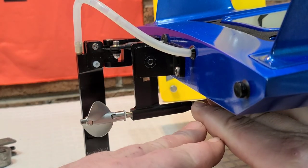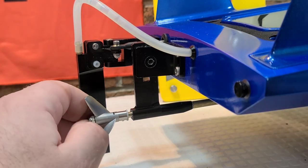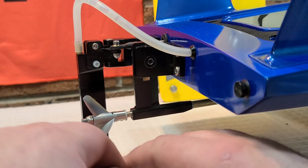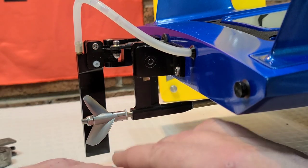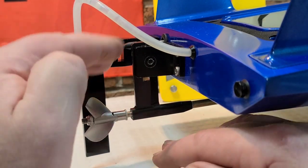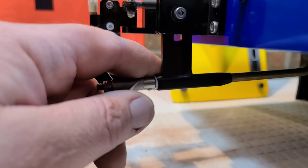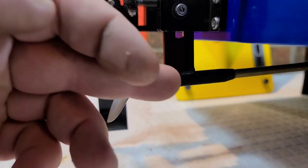They make these boats with a long stuffing tube so you can actually tune them yourself — cut the stuffing tube to length yourself. I'm going to push this up so it barely goes into the collet up here. So basically we only have that much cable in the collet — it's not very much for the collet to grab onto. That's why I've read a few guys are losing their prop shaft on the first and second run. When you get this boat, definitely check all your screws, make sure everything's loctited, make sure you've got enough cable going into the collet.